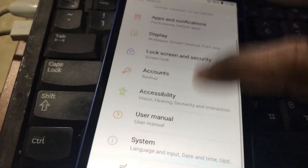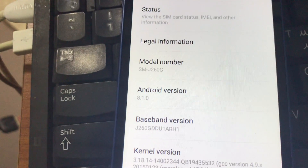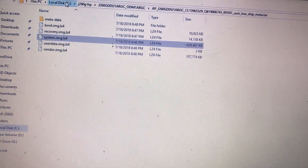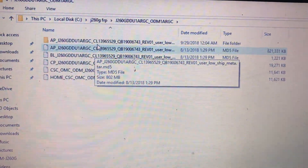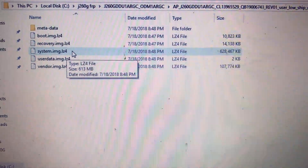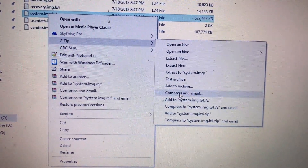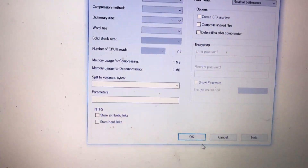The firmware flashed with the combination file system. Now it shows Android 8.1.0 — the latest version. So again: extract the AP file using 7-Zip, then go into the extracted folder, find 'system_image.lz4' — the 628 MB file — right-click, click 7-Zip, then 'Add to archive', and use TAR format. Click OK.